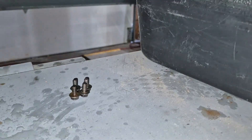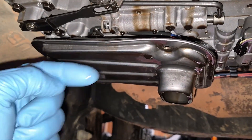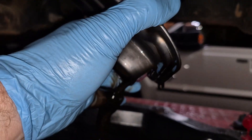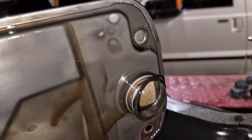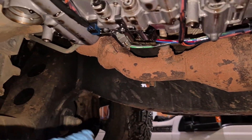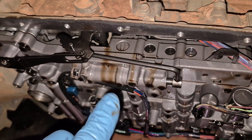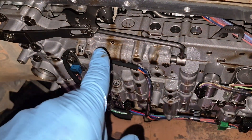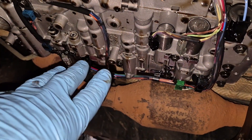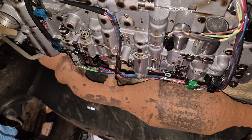There are four little bolts that hold in the filter pan — once those are out of each corner, one here, one there, and two on each side, then you're just going to slowly work it and the fluid is going to come out. You want to make sure the filter is not stuck up in there, because if you put the new filter on and that gets stuck up in there, that's not good. When you wipe this, you want to get it nice and clean. All this mud around here — you do not want to drop it into the valve body. Don't use cloths that will leave lint and dirt, because that'll clog the transmission. There are a whole bunch of small holes in these transmissions that the fluid flows through, and if you clog them up, there's going to be problems.